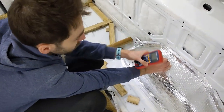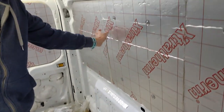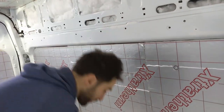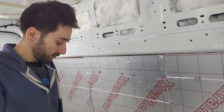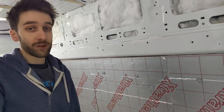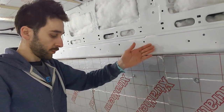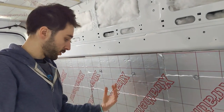If you have enough air gap with this reflective foil, you do get a benefit from it. But if I touch it directly, it completely changes and becomes conductive heat, which is a completely different kettle of fish. In order for it to radiate and reflect, it needs at least three-quarters of an inch gap. We have that here with the wheel arch. When we panel down the sides, there should be a natural gap all the way down, so we will actually get that benefit there too.